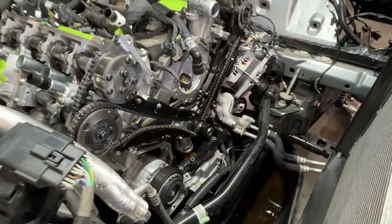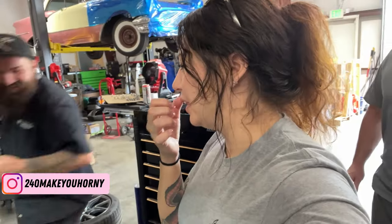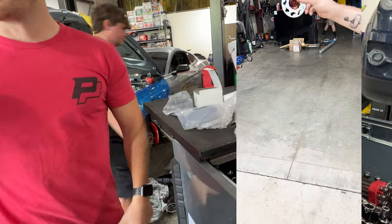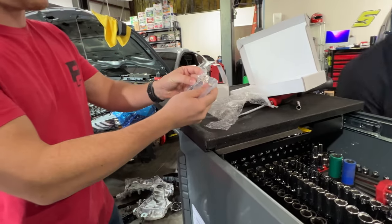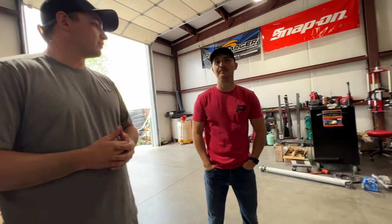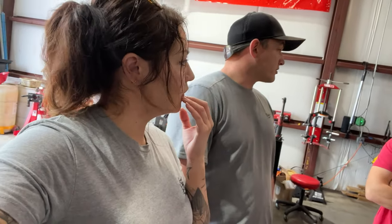So taking that out — there's little gears inside, we're just swapping those out so that it can support the power, because the stock ones are super brittle. Pretty sure you've been building cars your whole life. Jimmy and I actually went to school together. It's important that we upgrade these — these are billet and super strong. The ones that Ford uses are so weak you can drop them and they snap. So once you upgrade this, it's good for about a thousand horsepower. We don't really care about the number, just about feeling — it might make a tad more than 700, but probably around there.